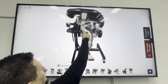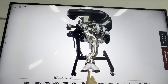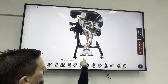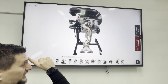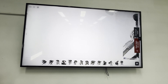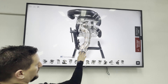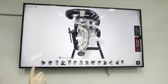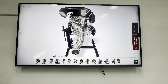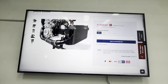Here you see the 100 millimeter downpipe going to the bottom to the V-band clamp which splits to a twin section. This is for the TUV street legal versions because they need to have catalysators. We also have the same option available as a race version — the same 100 millimeter downpipe where you bolt on a straight 100 millimeter decat pipe and can run this on events and motorsport activities. The kit is displayed on our homepage in various stages.